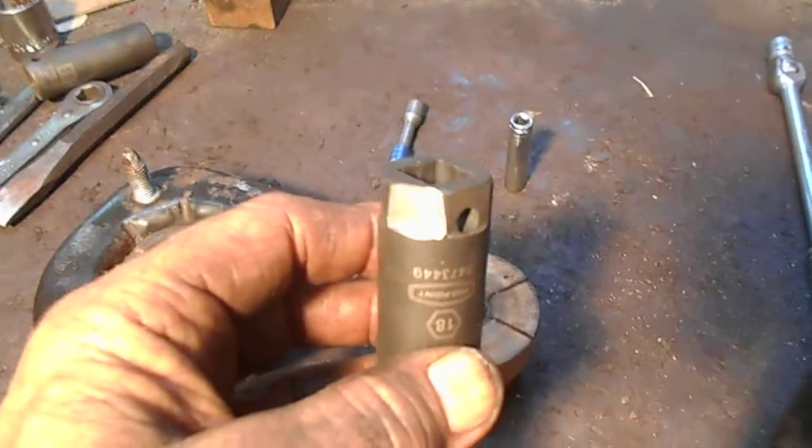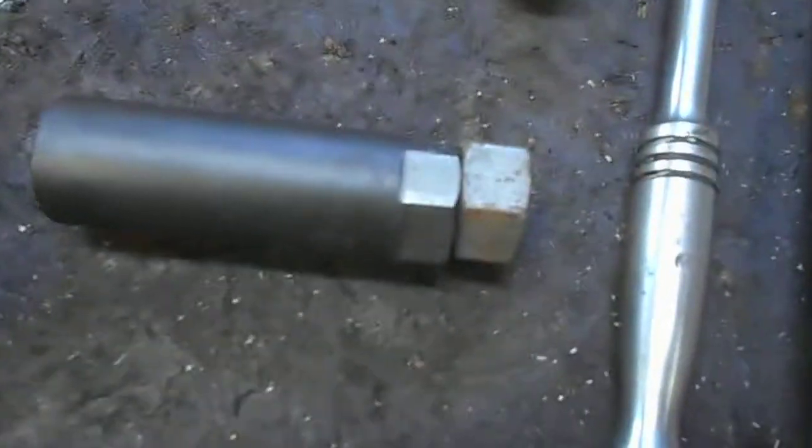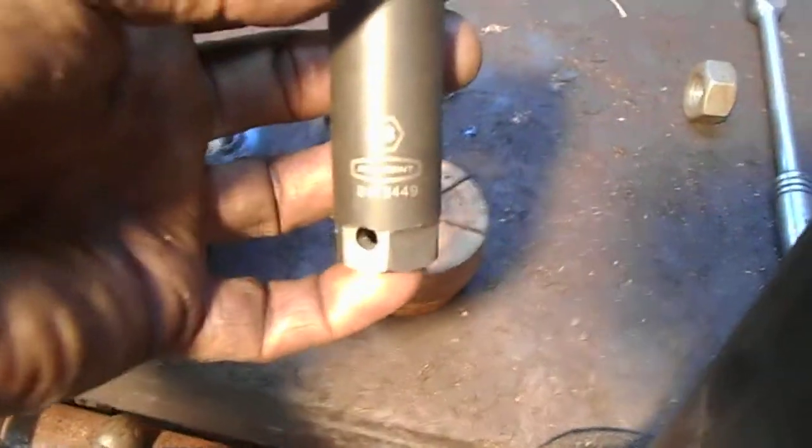The other way I also got the hex on top is I put this up against a nut — I'll just get a regular nut, which is not even the correct size. What I did is I put the metric nut up against it, ran a through bolt through it, and then just followed the pattern with a flat file until I ended up making a 24 millimeter, which worked out quite nicely. If I had not had this, I would not have been able to get this apart — I probably would have had to drill the side of the nut and try to split it with a chisel. But because I made this tool ahead of time, it worked out very well.